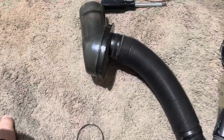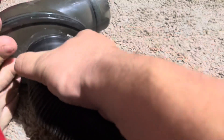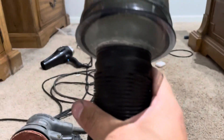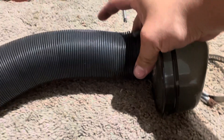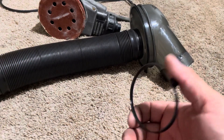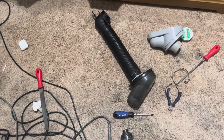If worse comes to worse, I do have a little hose clamp here that I may or may not have robbed off my neighbor's Dodge. We'll give it a run here in just a bit. Actually, the way I did it — if you don't get too carried away with it — it actually holds really well. I can tug on this as much as I want; it's not coming off. It took some heat to expand and stretch it over, and when it cooled off I imagine it shrank, just like a typical interference fit. It doesn't even need a zip tie — this won't come off. Fantastic. I'll put a zip tie on it anyway just for presentation purposes. There it is, all complete with the just-for-presentation zip tie on it — not even that tight. It's not coming off at all; there's no way that'll come off.